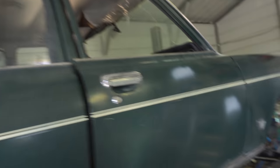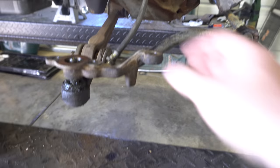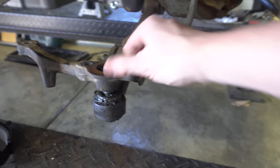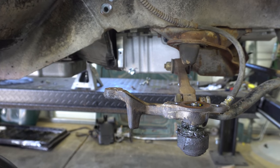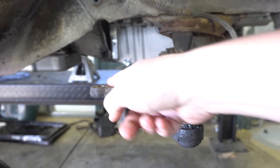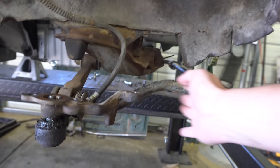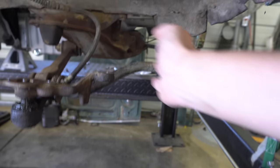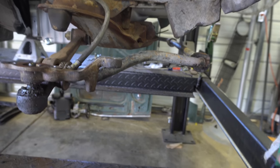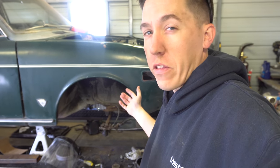And then I got to get some brakes and stuff like that ordered. We ended up getting the front struts off the car. What I was looking at is I had to spin this around because from the factory the steering linkage and everything came through the back, but with the new oil pan and all that that's definitely not going to work. So I spun these around — but I'm still quite a ways away from where the steering rack is going to be. So it's like the arm would need to be that much longer, or I got to slide the rack back into the car quite a bit. I'm definitely going to have some issues up here in the front end trying to figure out the steering.